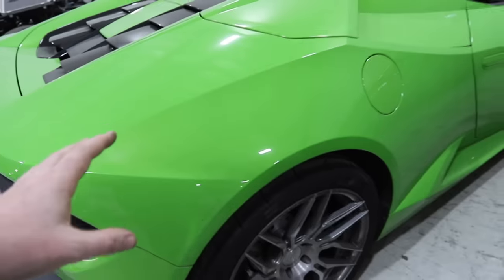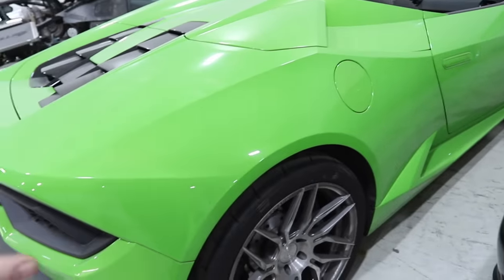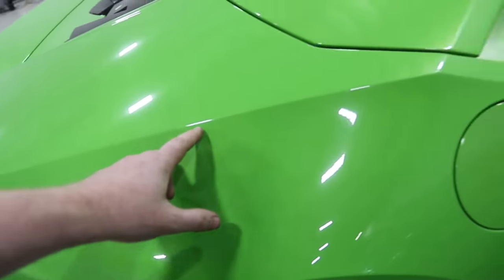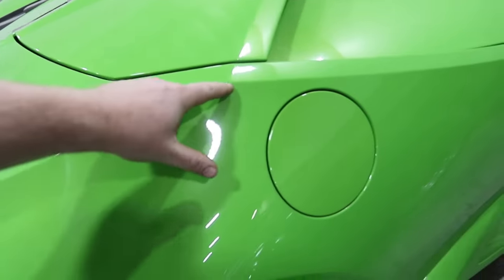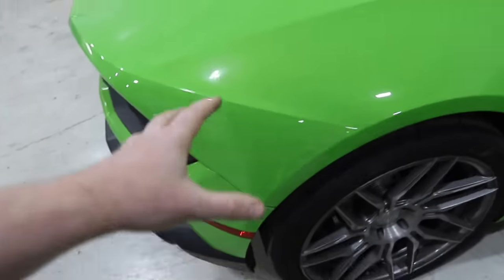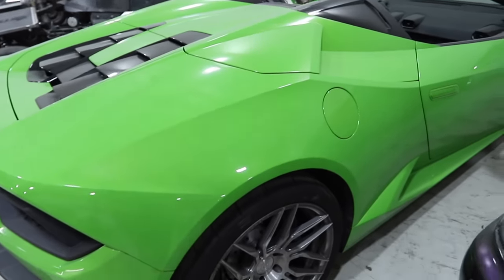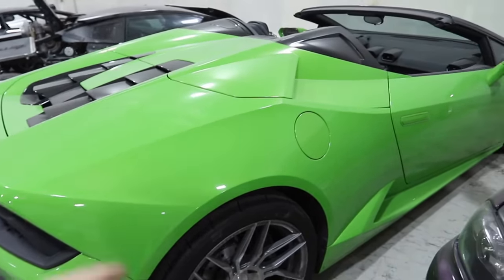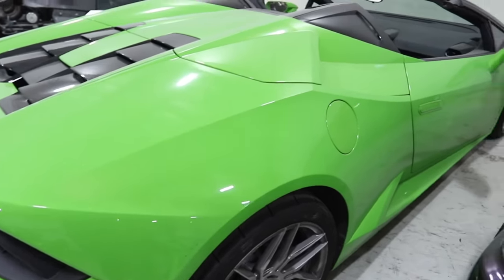Now the Lambo is the easiest version because it's almost all designed with peaks, so it's really easy. Anyways, if you wanted this, you run a rod from inside underneath there to there. One rod goes that way, one rod goes that way. You guys get the idea? We're building this inner structure and then throwing fabric over it, tightening that fabric down, and then we can fiberglass right over that. And we're basically using that as an interior mold.